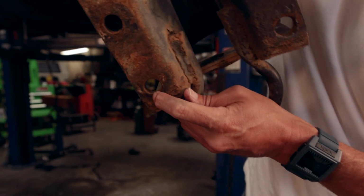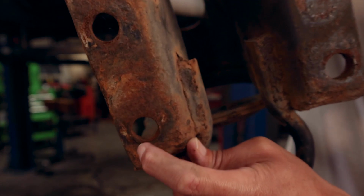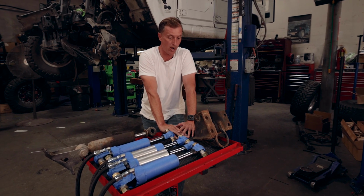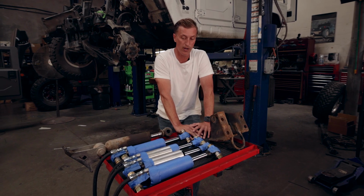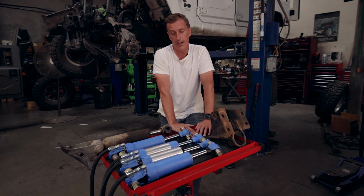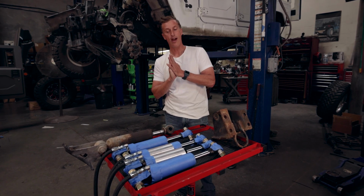And even inside of here, you've got these plates that are doubled up. You've got rusting going on in between those plates. So that's an issue. The shocks are a premium shock going on there that are valved correctly for the truck, especially the remote reservoirs. Really the next step up is like a coilover, which you can get into a bigger shock that route.